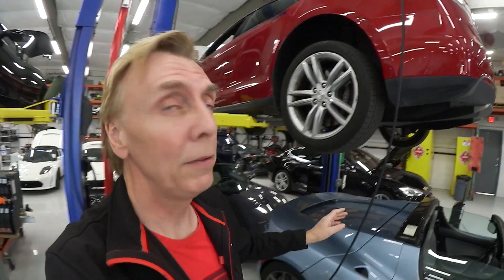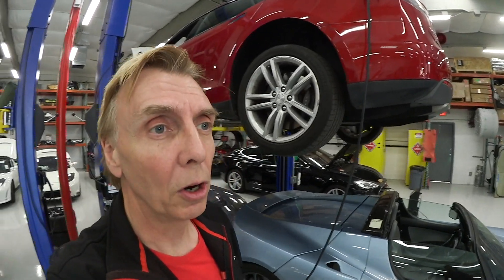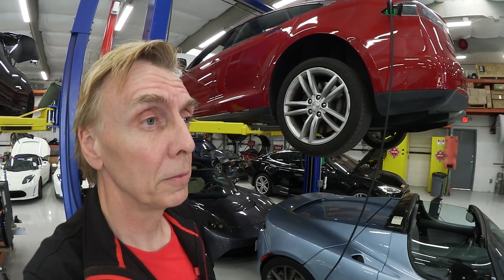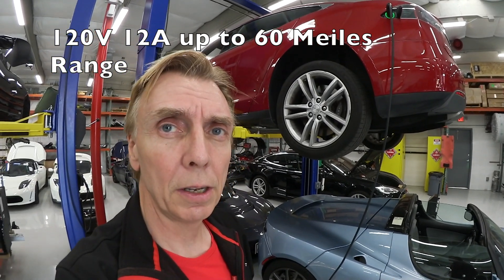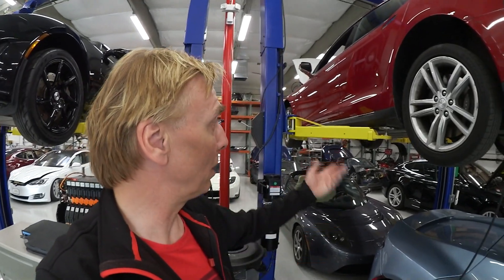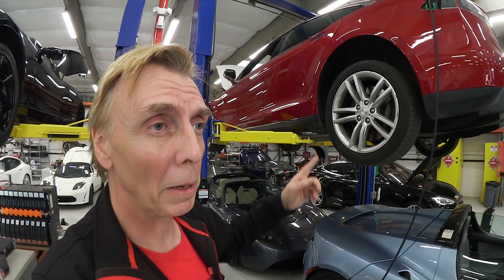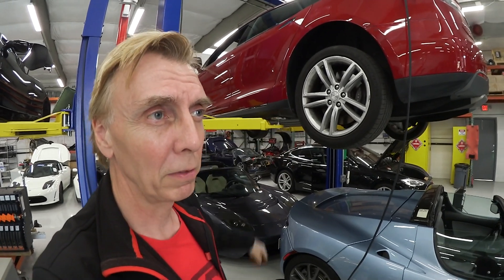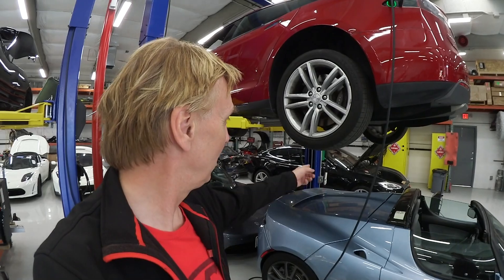An interesting thing is, the car, even when the main screen doesn't work, the car still charges. The car charges with 2A on 120V. I haven't tried it on 240, but I think it might be the same thing. What it does is it charges up to about 60 miles and then it shuts down, and it even charges up to maintain the battery so the battery is not getting dead. From time to time, they have to do that to maintain the battery, because probably the DC-DC converter is still on to charge the 12-volt battery — it still draws energy.